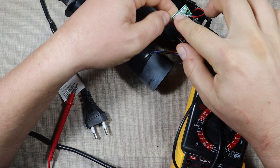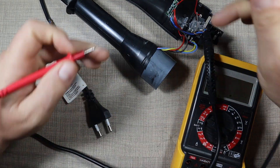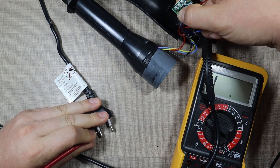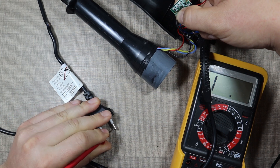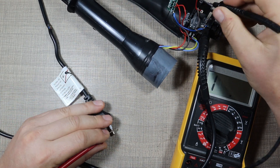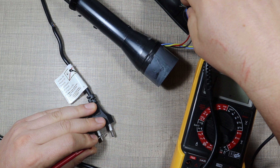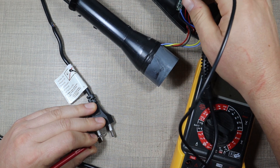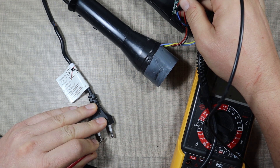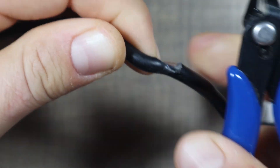Okay, so the LEDs are here and this is where the neutral wire comes in. It seems that we do have a broken wire — not the brown wire I thought, but the blue one instead. The brown wire goes through the switch and then comes to this board, but the blue one, which is typically neutral, is not making continuity. Let's see where it's broken. Since we already have this broken off here, let's finish the job and see if we expose anything else.